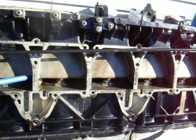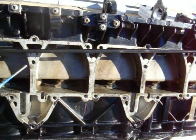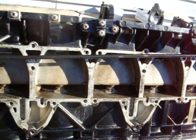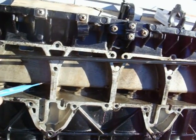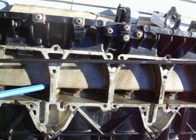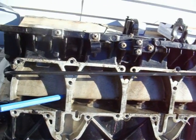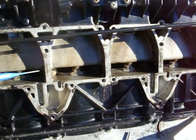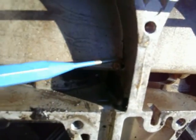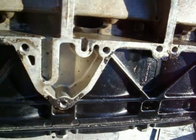What we're going to do today is reinstall the new ones, and the way that you do that is by first taking this and swedging this hole out a little bit. Because of the taper on the punch, we're going to stick it in the hole and smack it gently with a hammer, not to break it, but to widen that hole just a little bit for you to get the new ones in. And then once the new ones are in, you're going to swedge that teeny tiny hole closed again so that you can toenail it in. Let's just call it that.